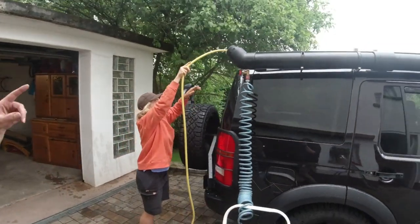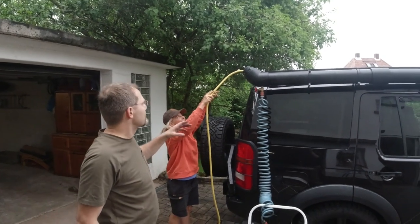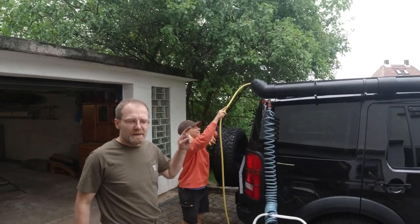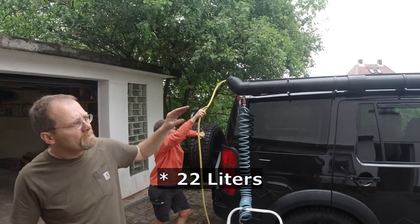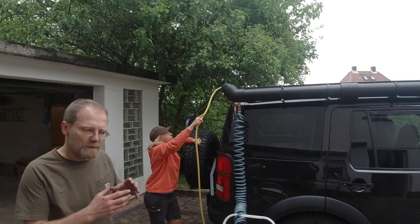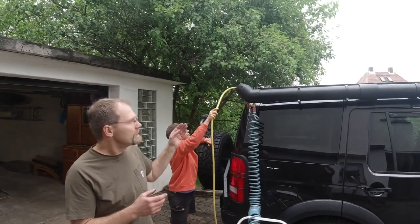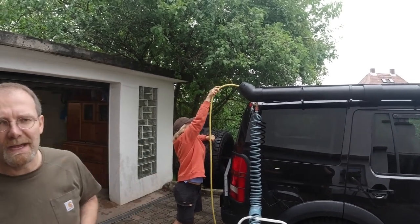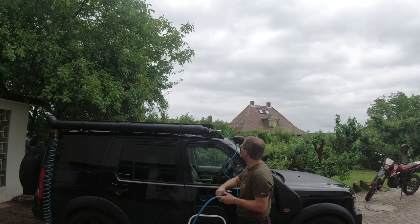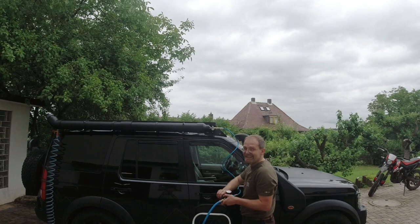So the capacity, it's okay. It's not going to be so bad. It's about 20 liters, I think, right? You need to keep an air bubble. Without an air bubble, you cannot get enough pressure or volume built up to drive all the water out. So you have to keep about a fifth of the capacity for the air bubble. I'm gonna get showered. I think that's all I got.